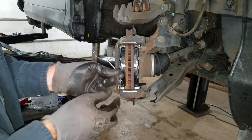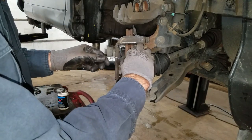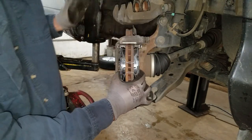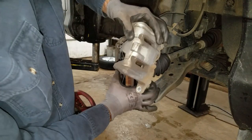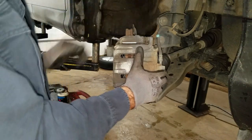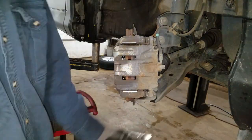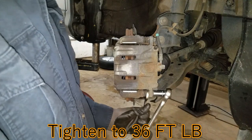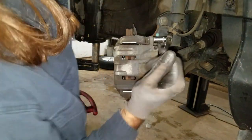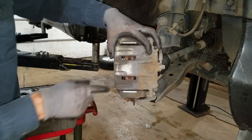I got new spring clips — these are fun. You put these in. When you do this, you always want to have a hand on it. Put this caliper on. You just got to make sure the hose isn't twisted — make sure you don't twist that hose. This pin's moving a little bit on me so I can stick a 19mm wrench on the square. Make sure the caliper moves really nice — I can already see the pads moving in there.